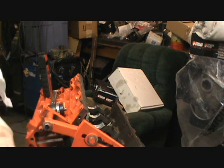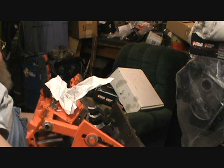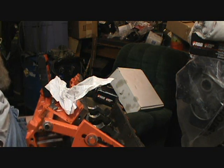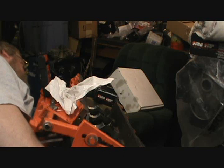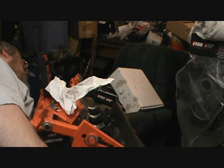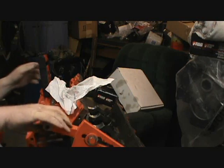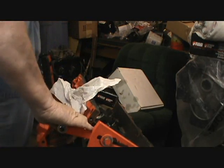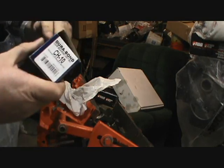Right now I got to be careful, because now I'm going through the cam bearings that are installed. Let's get to the front one. The reason for going all the way through like this is to drive the front bearing in square. So if you don't, you know what's going to happen. Okay. Now this one. There we go. Again, that's the CH-10.